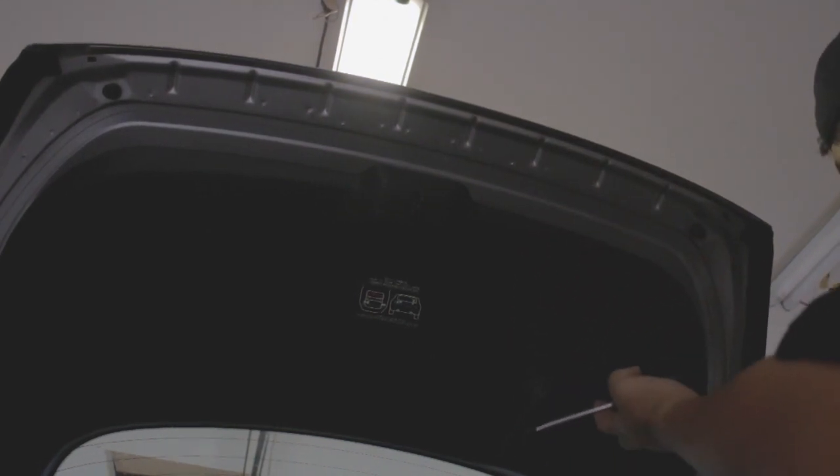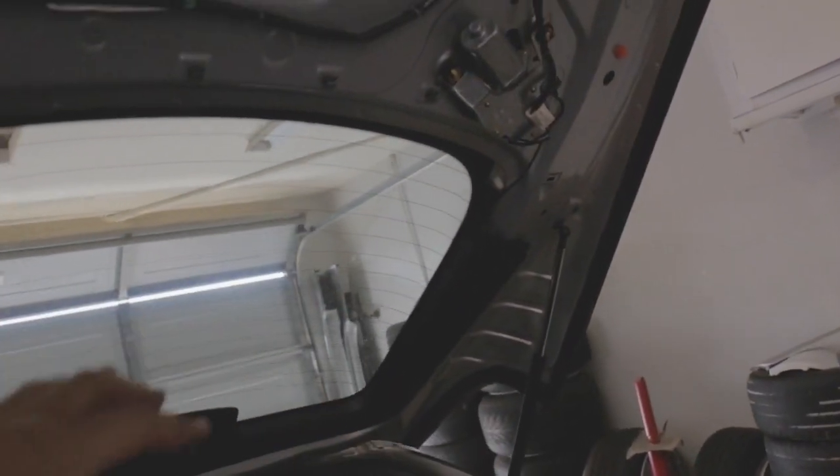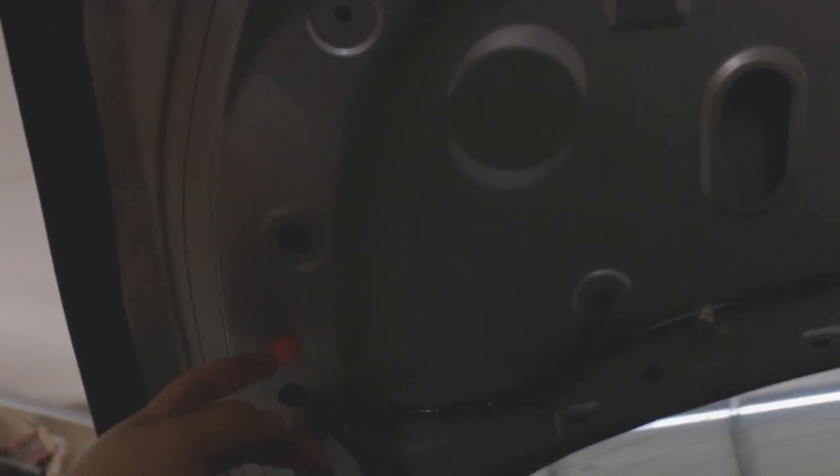You kind of just want to get something like a flat blade screwdriver, or if you have a pry bar for interior panels, take it and find a spot and just kind of pry it down. As you can see, the panel comes off in a half — the bottom half will come off but the top half is still along the top of the hatch. Now these clips kind of get stuck; you just want to pull them out, reattach them, and wiggle these metal clips out and press them back on.